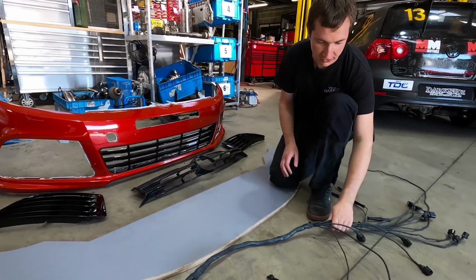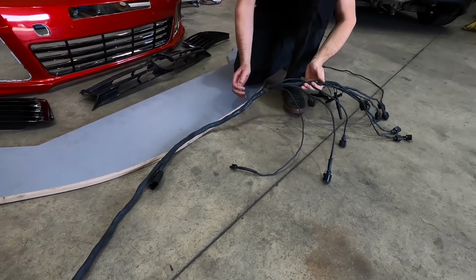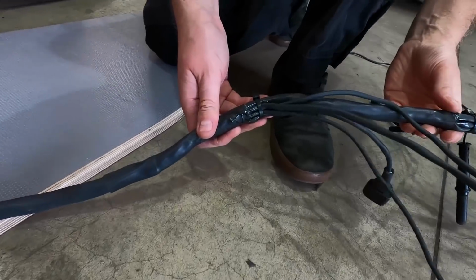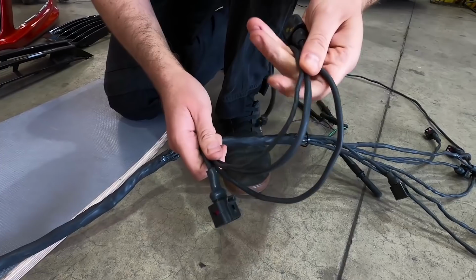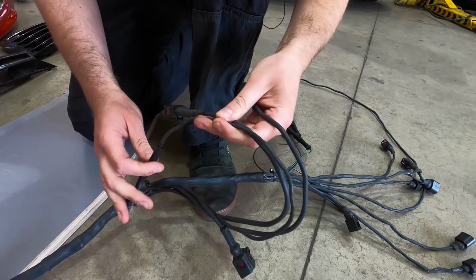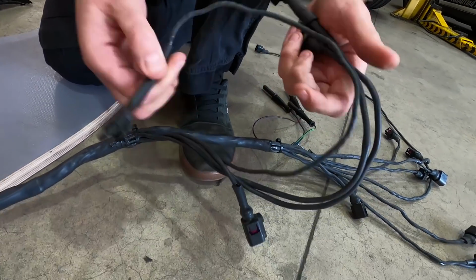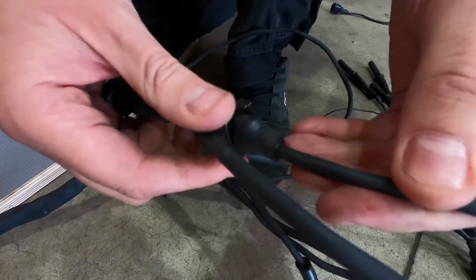So the other interesting thing that's here as well is the wiring loom. Now this took Paul absolutely ages to do because you have to strip every single connector off to get this on. But this is basically all the Raychem heat shrink, which I can't remember the exact model number, there's loads of different ones, but this is the chemical resistant one and what have you. And all the plugs have been potted in the back and heat shrunk, which is probably the worst one because it's not shrunk down nice. But see, they're going nowhere.